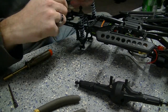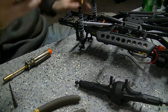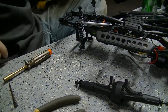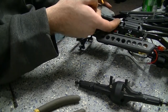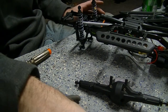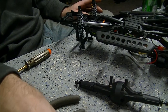Now this, unlike the others, like level 3, I had to kind of figure out how to do it. These came with instructions, which recommend removing the axle, of course, but there's so much disassembly required. I got a head start on it and removed all the stock hardware, with the exception of the bolts that hold the back of the side skids on, because the new hardware they give you is just ridiculously long. When I stuck it in there, it would be touching halfway across the chassis, and that's just not gonna float.